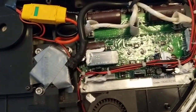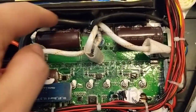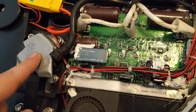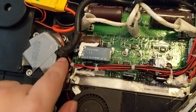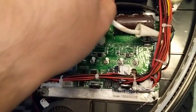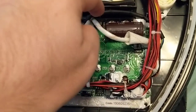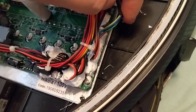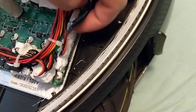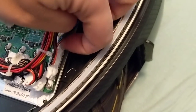You're going to unplug the battery. Other things you need to unplug: you'll see coming from the motor here — I have it taped, it won't look like this, it's just going to be gooped in with black silicone. This is the motor wire coming through here, and you'll see there's a little heat-shrinked wire coming off to the side with multiple color wires — that's the hall sensor cable. It's also going to have white silicone gooped on it, so you're going to really carefully pull the silicone out and remove the connector.